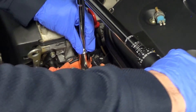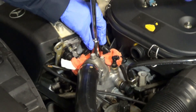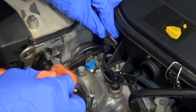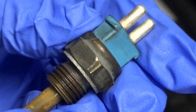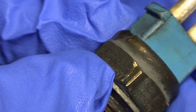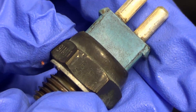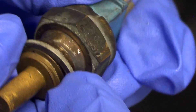I've got my torque specs here — it's got to be set at 25 newton meters. Looks like we got it. So let's take these rags out. You're definitely going to want to clean around there because we're going to want to see if we're losing any. I got the old one here and it's really hard to see, but I've tested this — it's no longer working, but it is an original Mercedes. You can kind of see the symbol. There's writing all around it — 91 M11. Made in Germany. This was clearly original.